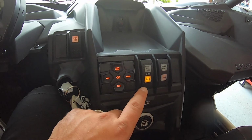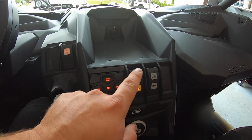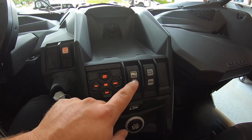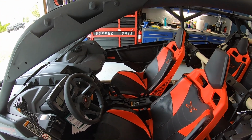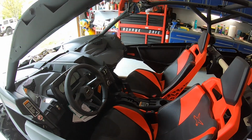In the manual, what it says basically is when you engage 4-wheel drive and then you lock your front diff, before you disengage the front wheel drive, always make sure to unlock your front diff and then put it into 2-wheel drive. And last but not least, I'll let you guys hear the stock exhaust on it, which doesn't sound terrible. It sounds actually pretty decent, which I do like that it's not overwhelmingly loud.